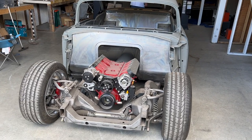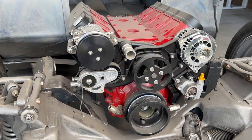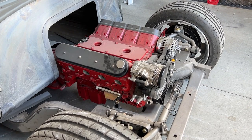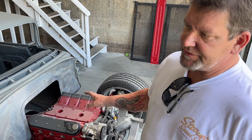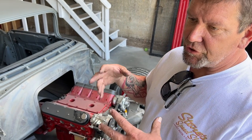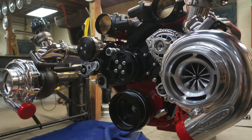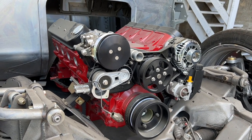Up front, we've got an LS six-liter block — an LQ4 block, basically a van or truck motor with a really stout bottom end and steel forged crank. I went with LS3 heads, brand new, reworked with hardened valves for the turbos. I'm running a Nelson Racing twin turbo system with 60mm Fast Spool turbos — mirror polished and mirrored so one turbo is the opposite mirror image of the other, allowing uniform plumbing. I'm running a cross-ram Edelbrock intake with dual throttle bodies, and the beautiful Vintage Air serpentine kit on the front.